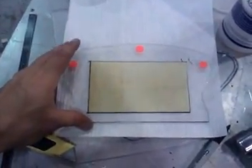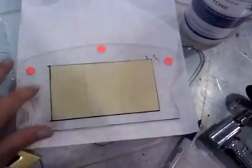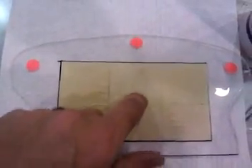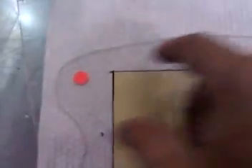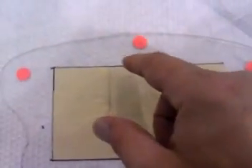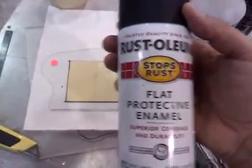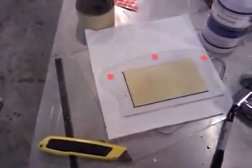I've taken this — the back side that's going to be facing the screen — and peeled off the protective coating on that side, leaving the protective coating on the other side until I'm done with my install. I've placed the little stickers — one for my engine light and one on either side for my blinkers — and I've masked off where my screen goes. Now I'm going to wipe this down with acetone, which etches the plastic a little bit and allows the flat black Rust-Oleum paint to actually stick to the plexiglass.